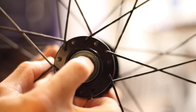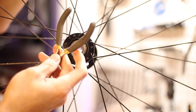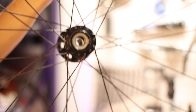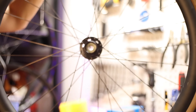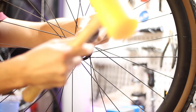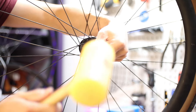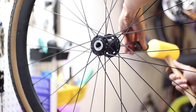Sometimes you can just force the sleeve to one side with your fingers, but in other cases you need a little extra leverage to slide it over. I like to use the rubber handle of a pair of pliers, as you don't want to gouge the inner surface of the sleeve with a screwdriver or anything like that. Basically anything rigid but with a soft contact patch would work well here. Once the inner sleeve is offset, you can stick a flathead in one end and tap out the bearing from the inside with a mallet. You don't want to apply pressure to the inner race of a bearing, but typically you're going to be replacing these bearings anyway, so it's fine in this case. Don't go too crazy and bash it all on one side — tap it until the bearing just starts to move, then rotate and hit from the opposite side, going back and forth so the bearing comes out as straight as possible.